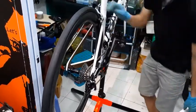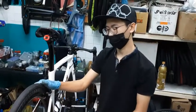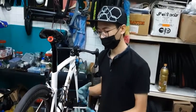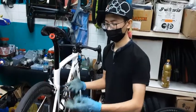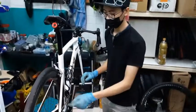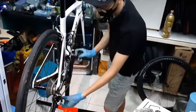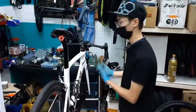Remember, if you have too much lube, it can cause more drag or friction because it attracts more gunk and creates additional resistance. You want just the right amount — enough to sip in between each link. Wipe off the excess and you're done. That's all. Then install the front wheels.